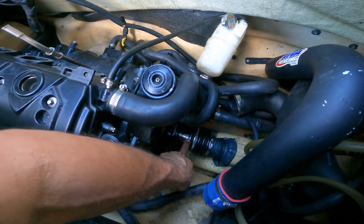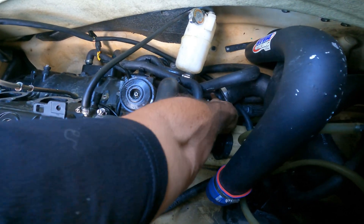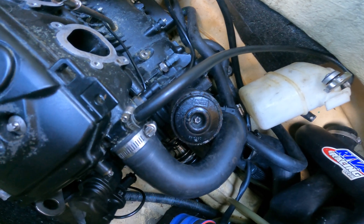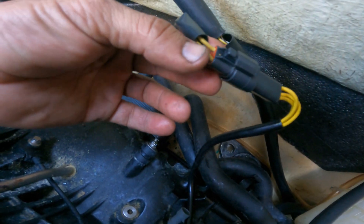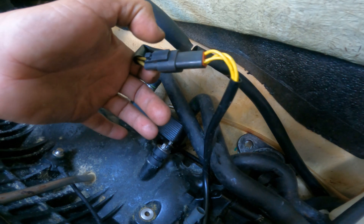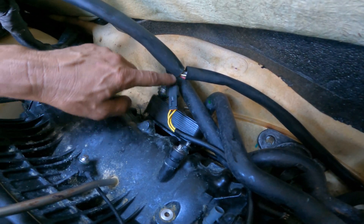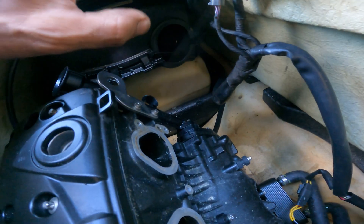The motor is in. We put the carbon seal on because it's nice and easy, tighten the cooling hose and the one on the bottom. Put this plug into your charger system — make sure it's clipped in because sometimes this little clip doesn't clip. If you notice, this side is really yellow and this side is kind of brown — that's because they heat up right here. This connection is really bad; it doesn't really work for the kind of current going through it. On the new 2021 models, this plug goes all the way to the charging system with no mid-connection like this.